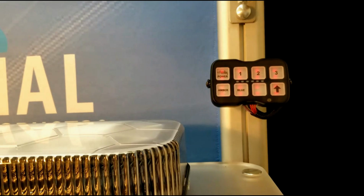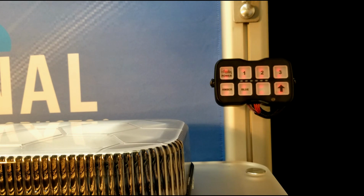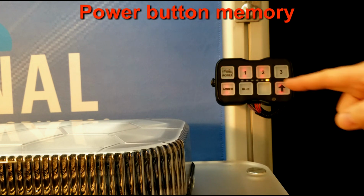So that's a low current output, high side switch only. So if you need to do additional lights and not trigger wires, you're going to need to use an external relay. But if you're just triggering some wires on your stick or on your light bar, that's going to be plenty for you. So I'm in my program mode now.